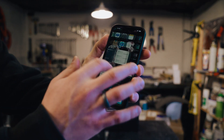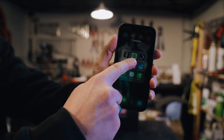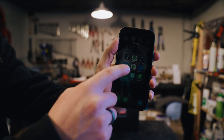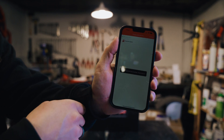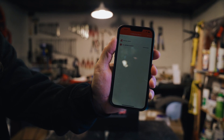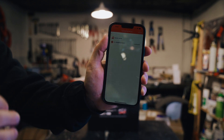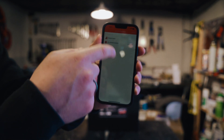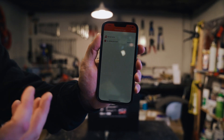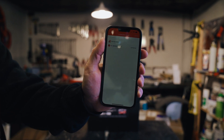So if it's been inactive for a certain length of time, it'll turn the Bluetooth side of it off so it doesn't waste power. But rest assured, the BMS itself is still working and doing what it's supposed to do — keeping the battery balanced and protecting the cells. Now I'm going to jump in and show you how to connect to it. I'm going to find my app here. This icon here, that middle one — it says Smart BMS with the green little circle emblem. That is the app you want to connect to. When you tap it, it should come up with your battery number in the list. There's no need to connect to the Bluetooth in your phone's settings or try to pair with the device.